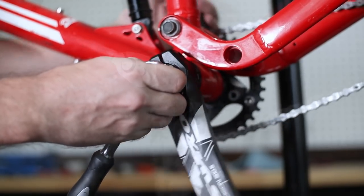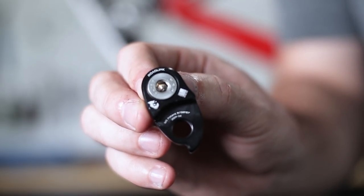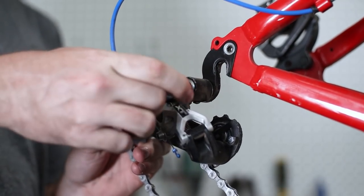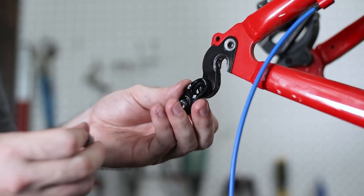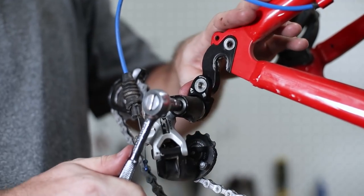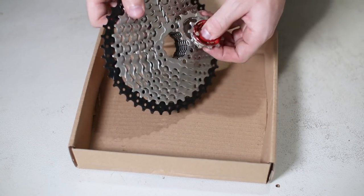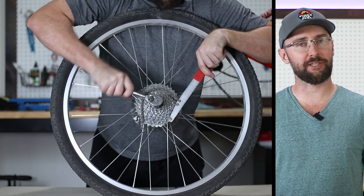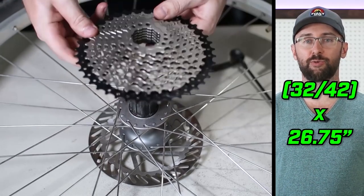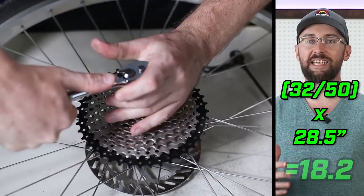To get this bike to really sell, I want it to have some pretty appealing features. That's why I picked up this Wolf Tooth Road Link Derailleur Hanger Extender. The packaging says this can make it go up to a 40 tooth, but since this derailleur is a medium cage, I think it should work. Now that I can have a wider range cassette, I'm going with an 11 to 42 tooth 9-speed cassette because this derailleur is already 9-speed. This cassette was provided to me by ZTZ and retails for about $30. We can calculate this using the gear inch calculation — a 32-42 gearing with 26 inch tires comes down to 20.38 gear inches.